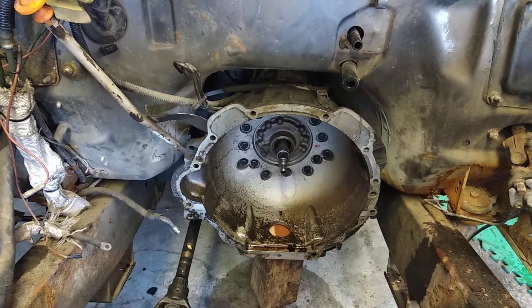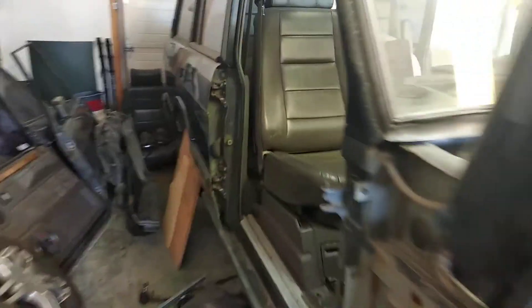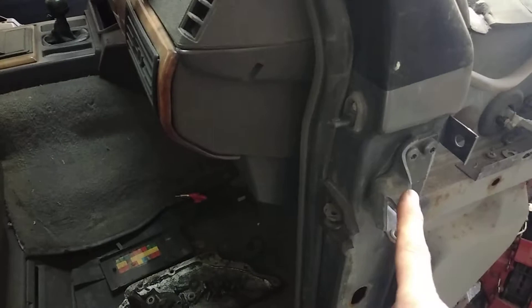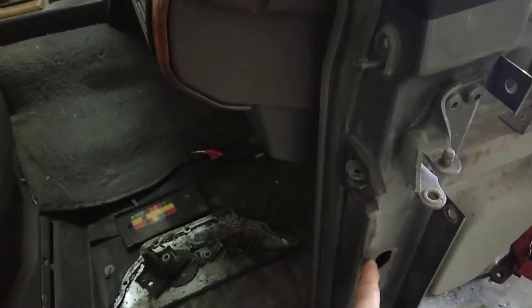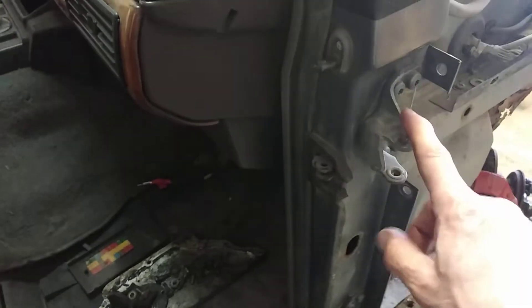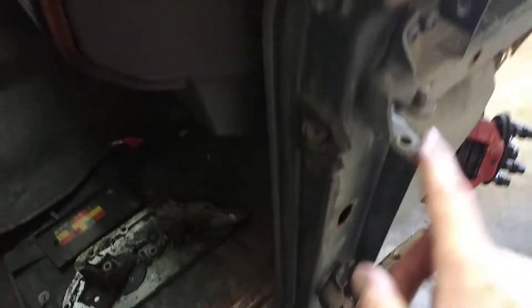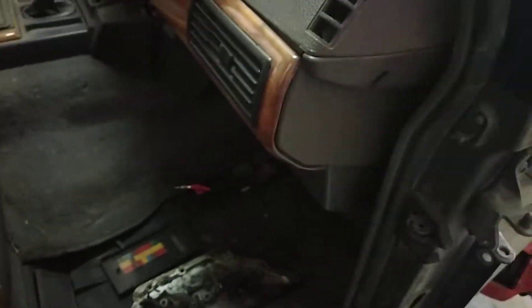Once that's on the floor, I'm going to be ripping the interior out. Let's just walk around here — taking this door off. If you've never taken one of these doors off before, it's very simple. Just feed your electricals through here, and there are a couple of C-clips on the top and bottom. Just clip those off and the door just lifts off. It's less than five minutes — very, very easy.